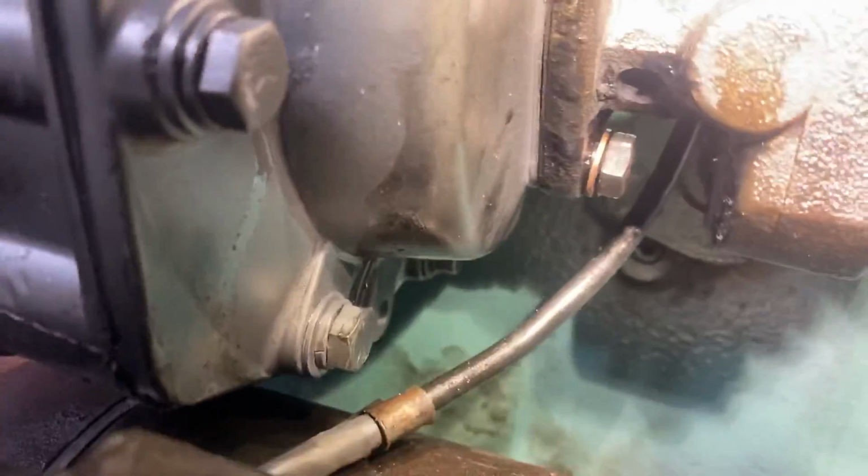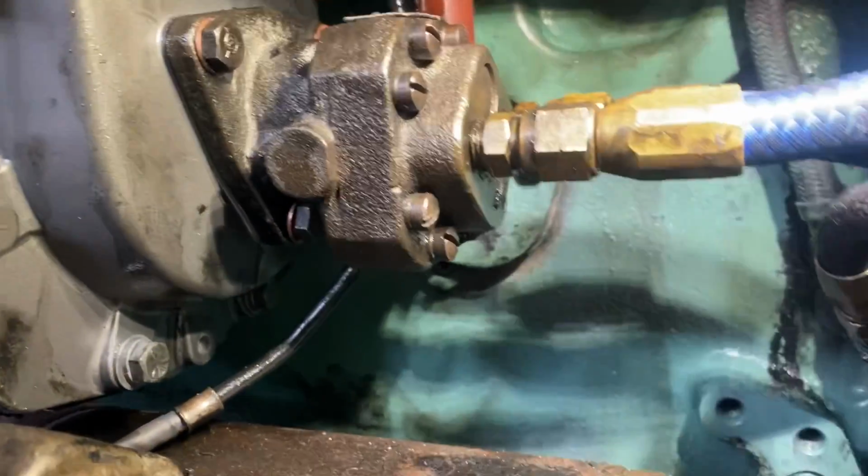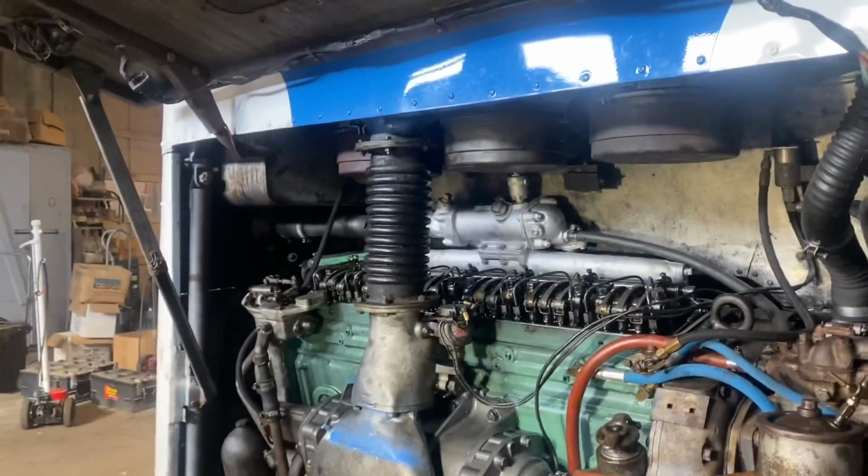That oil leak is, I didn't put that bottom fuel pump screw all the way in, so it was leaking down onto the starter, rolling down the starter right there, and that's what that little puddle is. That's just tightening up a bolt. Start it up inside here, and we're going to short out each injector. We're going to figure out which cylinder's missing this morning.